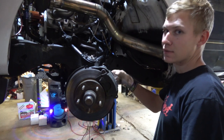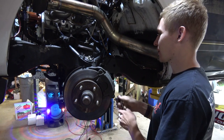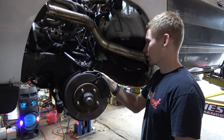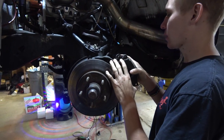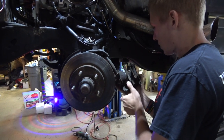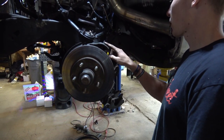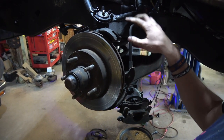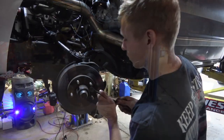We're starting to go faster and faster and it's getting harder to stop. At Magnolia I ended up in the grass a couple times. It's really dark down there so it comes up quick. We did a little slide in the grass but it just adds more excitement. So we've got the caliper bolts out, we're going to slide this caliper up out of there and just let it hang. The pads don't look too bad. We're going to replace this brake hose too with some braided hose, a little bit longer, so when we get more travel we're not going to overextend it and break a brake line.